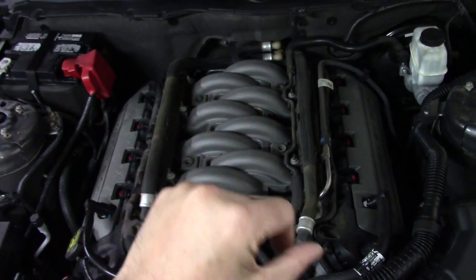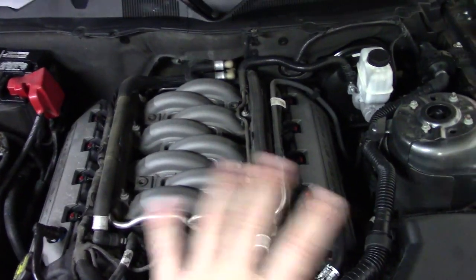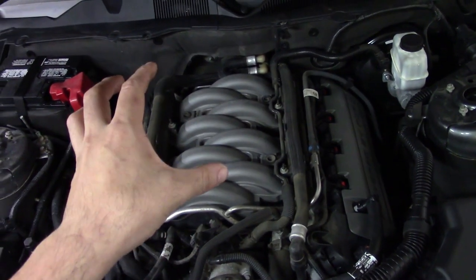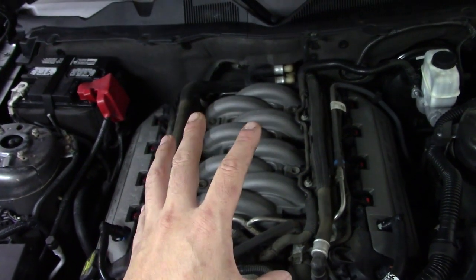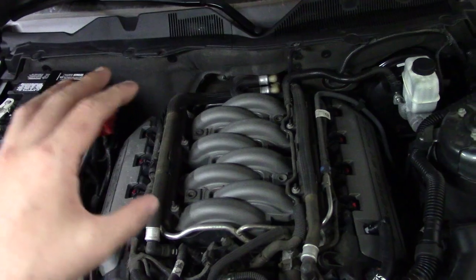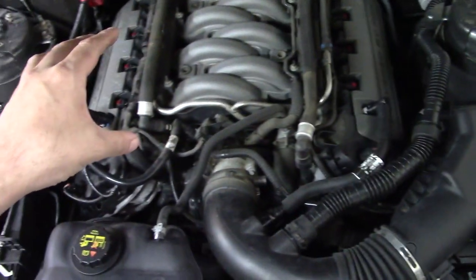It's European in design, 32 valve, 4 cam, lots of power without having a lot of displacement, but it's still using simplified parts. So the water pump is not something goofy like on the old LT1 with the OptiSpark, which sat in front of the water pump. None of that stuff.